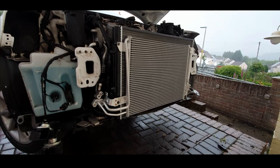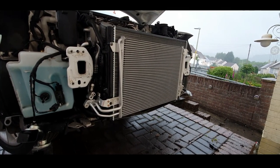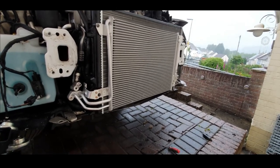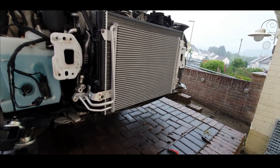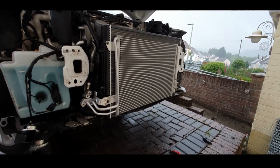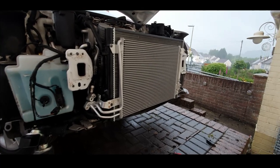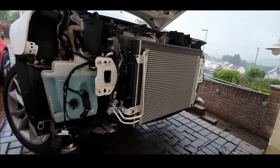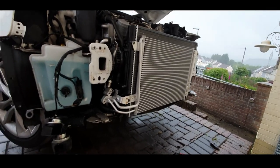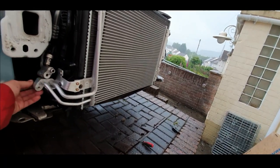I'm going to fill it up with water and just pressurise the system a little bit to make sure there's no leaks. Then I'll drain it from the bottom pipe and put fresh antifreeze in it, because antifreeze is quite expensive — if it's leaking everywhere I don't want it to go to waste, so this is like a trial. I also need to see if the fan works, because if the fan doesn't work I'm going to have to take it all back off anyway. I just want to get the car running and see where we go from there. Let's get this aircon plumbed up.